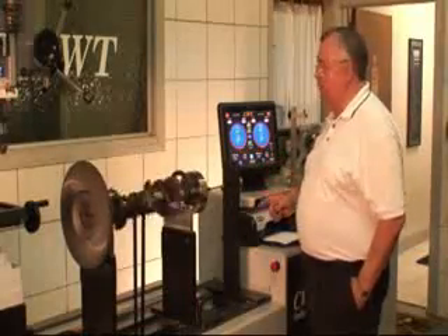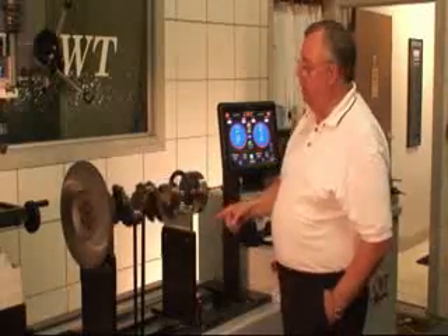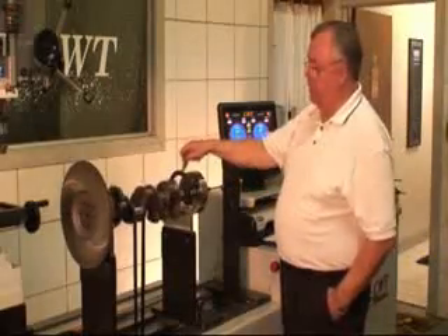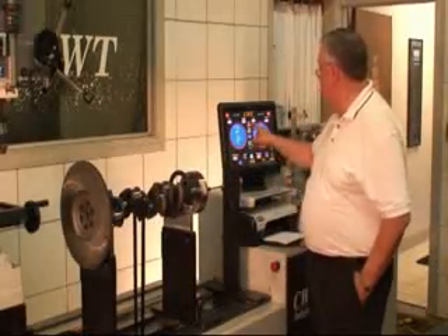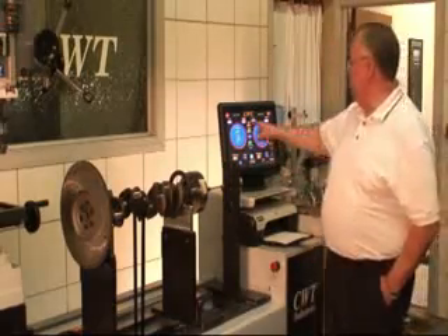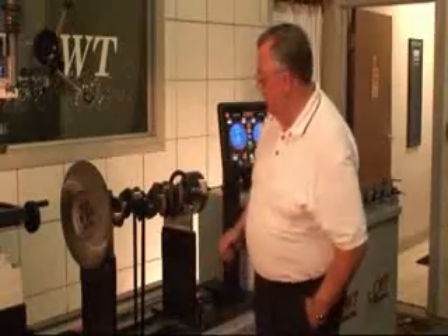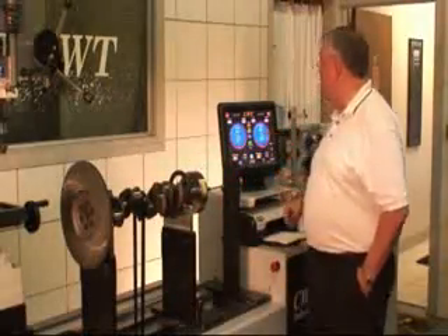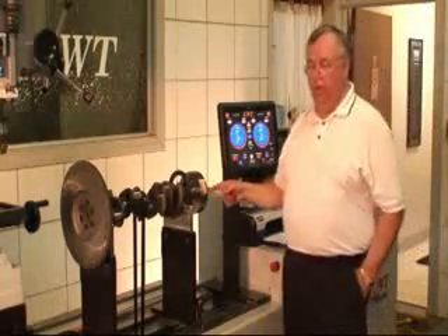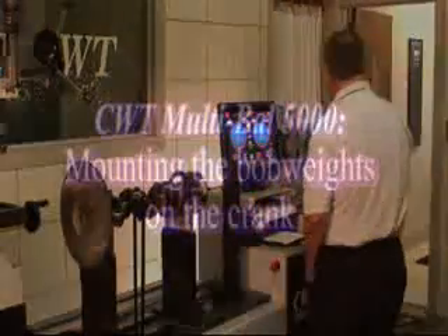Now, what's important to understand is that if you spin this at the normal 500 RPM, it's so far out of balance it could become unsafe — and that's the purpose of the safety straps. Right now this particular application is showing 951.78 grams of unbalance on this side, and on this side it's showing 949.59 grams. Trust me, if that spun at 500 RPM, it would try and chase you around the room — so it's a bad idea.